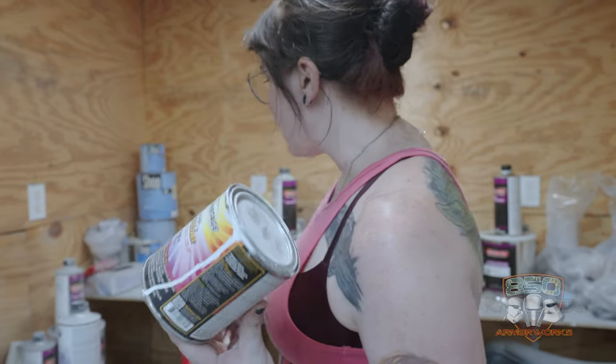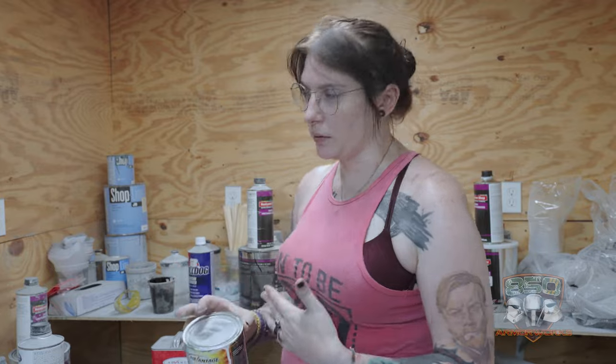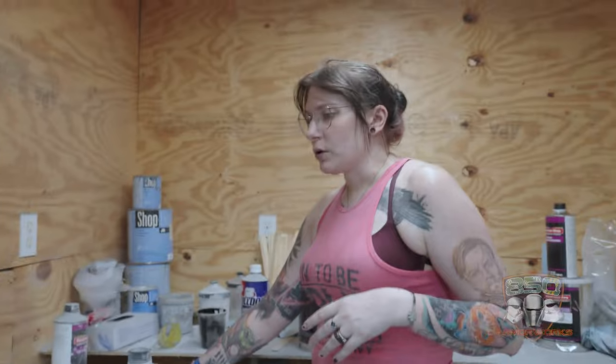When you lay it down, it lays down much, much better when you have a base coat, like a white base coat or a black base coat, depending on what color you're painting. It helps it stick better, and it lays flatter, and it does help with some of the runs. After we do the base coat, it dries pretty quickly. With the base coat, it's 1-to-1, one part paint, one part reducer, and pretty simple. You are able to safely store any that you've got left over for later use.